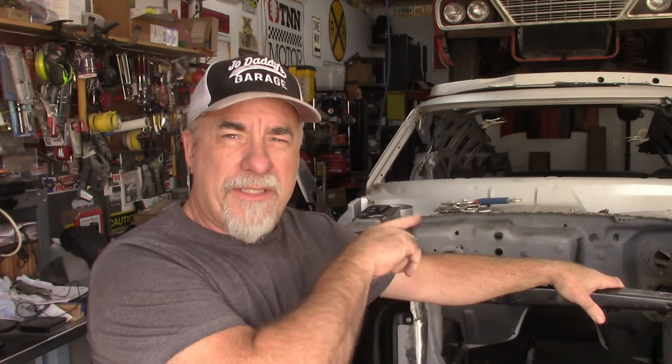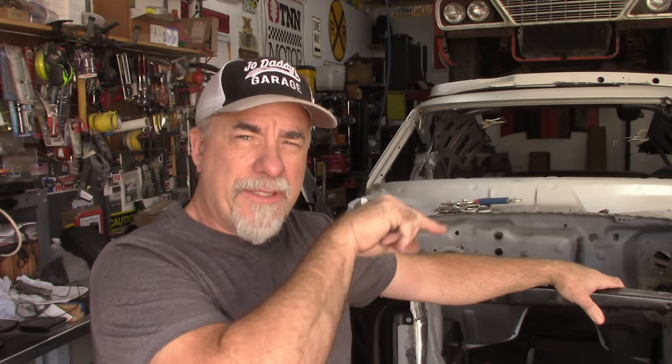All right, that'll be the end of this video. Now, there's still more to do. I need to prep the inside of the lower cowl. I need to put seam sealer around that chimney and prepare everything for the upper half to go on. That's going to just take some more work, and I'll do that in the next video. I also have to put in the air boxes, as I mentioned previously. And in future videos, I will be working on the torque boxes. That's always fun. And putting in the frame connectors. So there's still a lot more to do and a lot more to see.